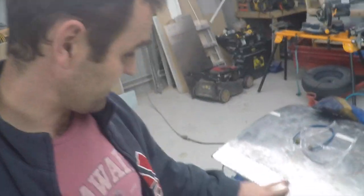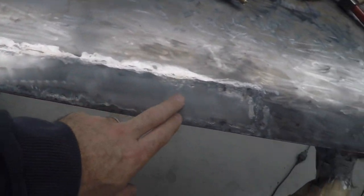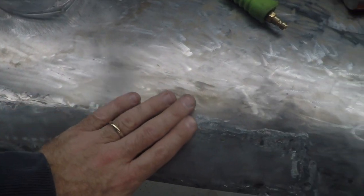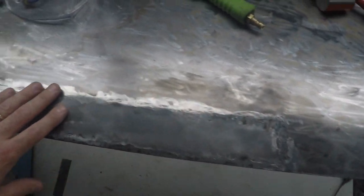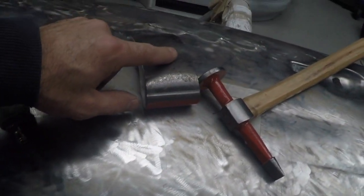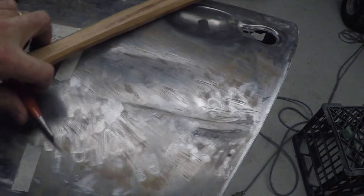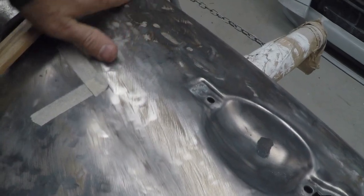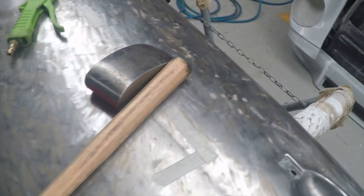Now you can have a look - I've finished welding in the panel and grinding everything back, and it's all looking reasonably good. But there's quite a low here and it's proud here - as I've welded it, it's stretched and shrunk the metal a bit. Basically what I've got to do now is get the hammer and dolly and go in underneath to try and get this back out to a nice shape. I'm also going to go through these large dents here and see if I can bring them all back into looking a bit tidier.